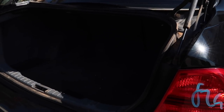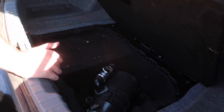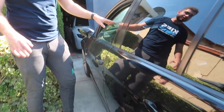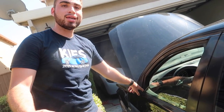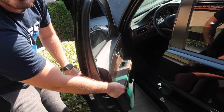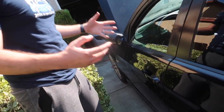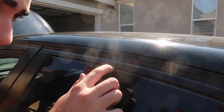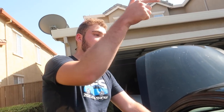We got all the garbage out of the trunk so the trunk's good to go. We found a garbage disposal — an InSinkErator — in there, so we might have to take that to a car wash dumpster. The most primary issue is we can't roll up this window because every time we roll it up it gets jammed. You can actually tell the person who installed it was inexperienced. Basically, whoever was doing it literally messed up this entire door panel. We're going to take the door panel back off and try to readjust this window and the window regulator. We also need a new mirror. The goal is to get this window to work for zero dollars so we can at least close it and wash the car.